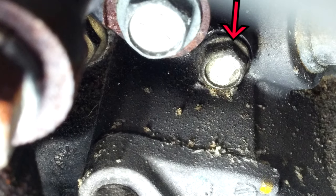These next pictures are pictures of the bleed bolt. You take this out and it will bleed the air out of the system when you're putting the coolant back in — there's air trapped in there and you've got to bleed it out. Wherever you bleed it from, it's got to be below the radiator top or you won't get all the air out. If you get an air bubble, that's not good — the car can overheat.